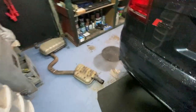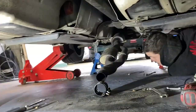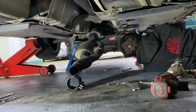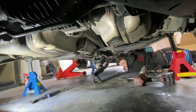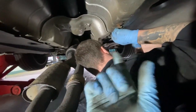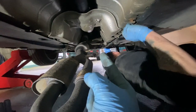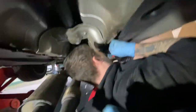We've got the center from the rear of the exhaust off - that's it, so we're good to go. It's off now, we just need to deal with this downpipe and lambda sensor. We need to pull down and cut this plastic protector just so we can get the lambda sensor wire and unplug it to get the lambda sensor off. We've also got that mount off down there as well - 13mm bolts. We're almost there.